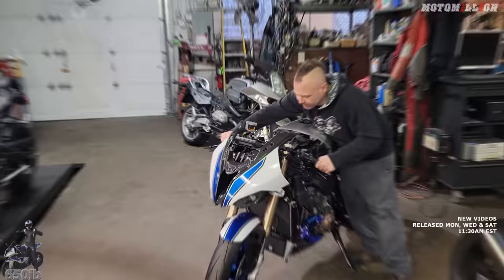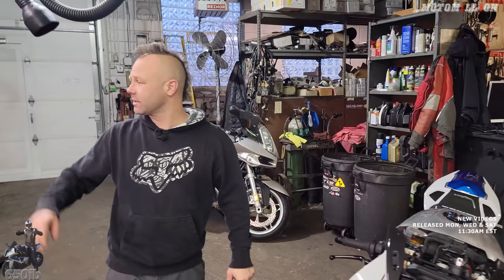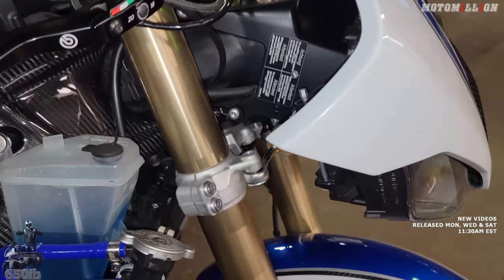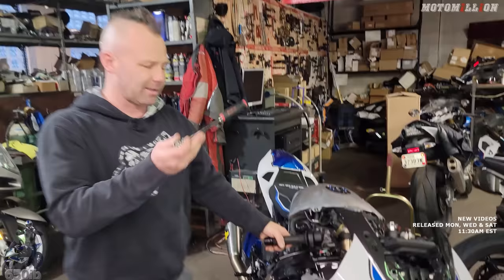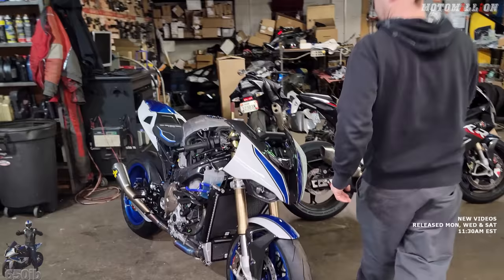Just checking that our bike makes it to the steering lock going both directions, which means our steering damper is not interfering. From what I can figure out from the old Ohlins instructions — my box didn't come with any instructions — it looks like they changed the way that the steering damper mounts. You can see there's no spacer here, and it uses a smaller spacer where this black piece is at. It seems as if they've moved it up on the bike. The original instructions show the other setup, but it doesn't work — if I put that spacer there and use the spacer we have, it's crooked. It's mounted, it's not going to go anywhere, it's not unsafe. I'll try to do a little more research and see if that's 100% correct.